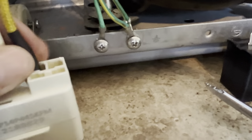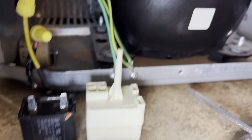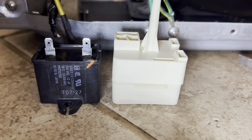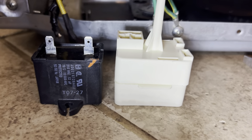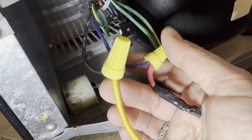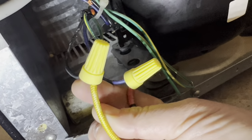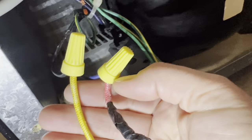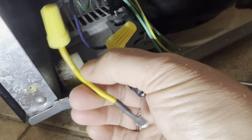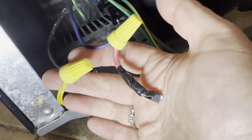Let me pull this out of here. So you can just see that it pulls straight up. Here are the pieces I'm going to take to my appliance parts store. This really took me less than 10 minutes, and that includes pushing out the refrigerator from the wall and unplugging it. I want to note that somebody did some work before on it — this wire was originally black, this one was originally blue, and whoever fixed it only had yellow and red. So ignore these colors and pay attention to the black and the blue when we go back to putting things together.